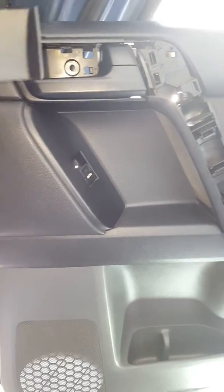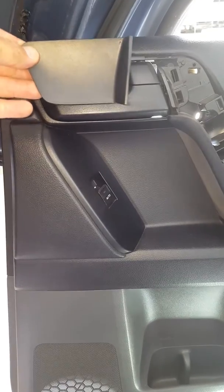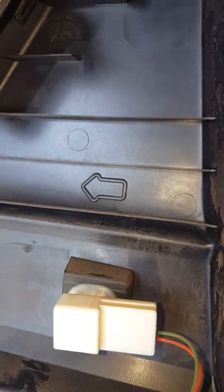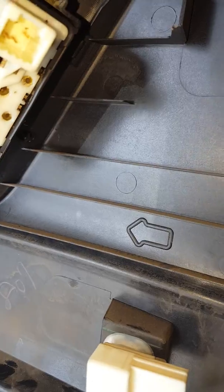From removing the door trim, basically you remove this plastic cover. There's a screw hole here, another screw hole here, another screw hole here. Remove those screws. Once you've done that, basically on the inside of the door trim, you have your power window and your connection for your door light. Unplug them and you should be able to remove the trim in one go.